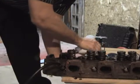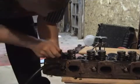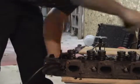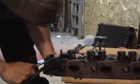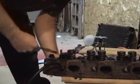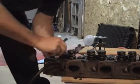Okay, now we're down to the valve seal. And some valve seals are installed different than others. Some of them can be quite tight on there. Usually you can take a screwdriver and just pop them off, or a pair of pliers, or a vice grip, or something like that, where you can just kind of give them a turn and they pop off.